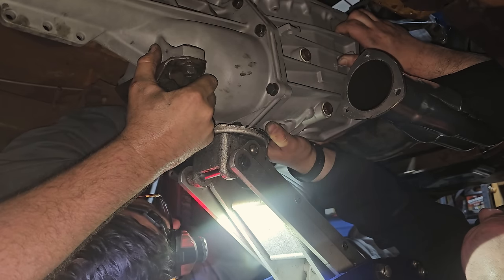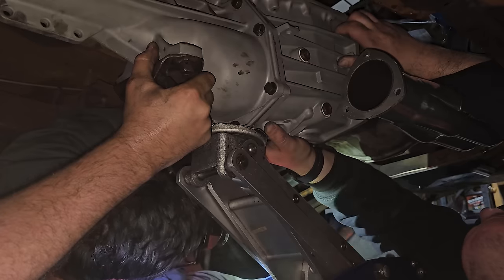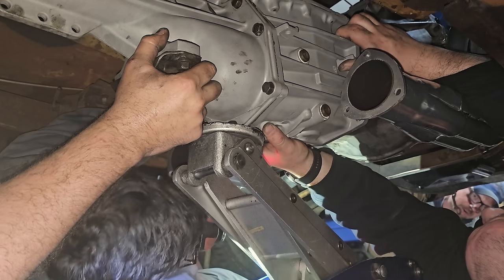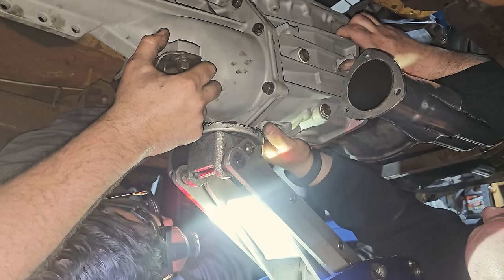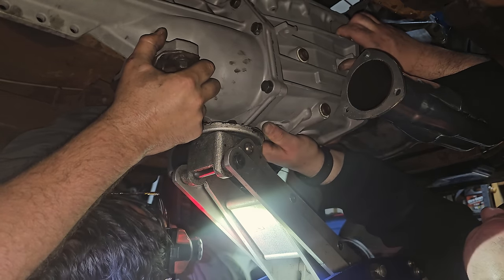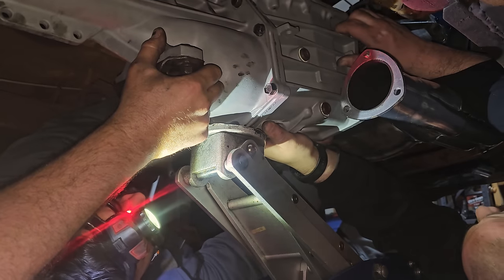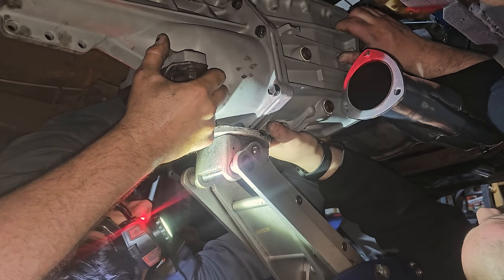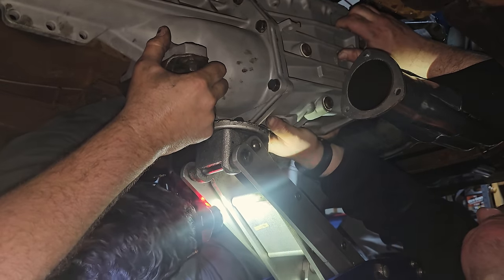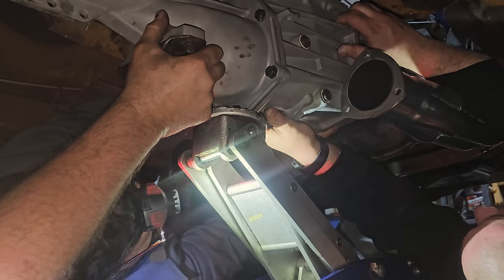We should put some grease on this bearing retainer, maybe. You want some? Just hand me a little bit. Yep. Thank you. Tony's gonna put a little bit of grease on the bearing so it'll slide onto that input shaft a little easier so we can line that pin up. And he's limited by the travel of the hydraulic lines. Do we want to bring the back up a little bit? That's what it looks like to me. The back needs to go up. Jason, could you give it a pump? I mean, we're not going in yet until this is on. Yeah, just the angle. Another one? There we go. Should be better.